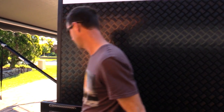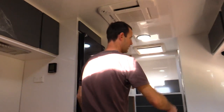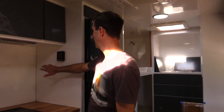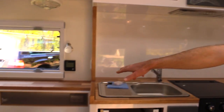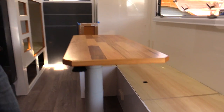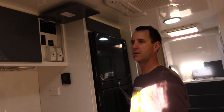Anyway, we'll go inside and check out inside. First up we've actually got some lights in here now, which is awesome - these little touch lights. We've done all the 240 volt power, it's all hooked up now. All our GPOs - we've got a double there, a double up here in the bedhead, another one under the dinette, and they're all hooked up to the inverter as well.